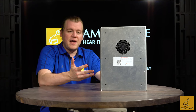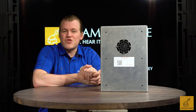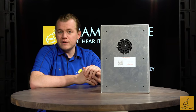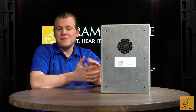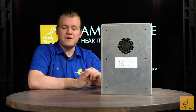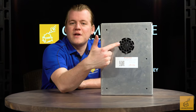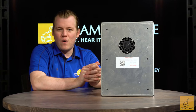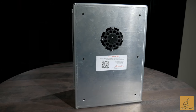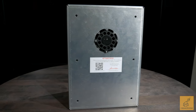To give you an idea, these are rated down to a realistic 38 Hz. That is bonkers and unheard of for an in-ceiling product — it's something you would expect to hear coming out of a tower, not a ceiling speaker, and especially not one that comes out of an aperture barely three inches wide. On top of the excellent bass performance of the hidden six and a half inch woofer, the concentrically mounted two inch midrange and one inch dome tweeter provide wonderful off-axis performance.